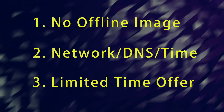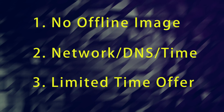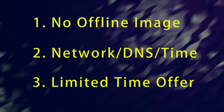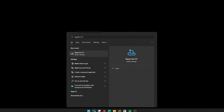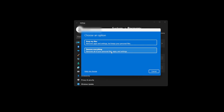While you can install just about any version of Windows Home you want and then install Armory Crate SE and the necessary drivers directly from ASUS, some might prefer to use the stock factory image. Personally, I found that using the stock image results in the most stable experience on the Ally. You can normally use the reset this PC function within Windows to get back to factory defaults if you're planning to resell the device, but for this guide we're looking at a scenario where you can't boot into Windows or your recovery partition is corrupt and you need to wipe the device.